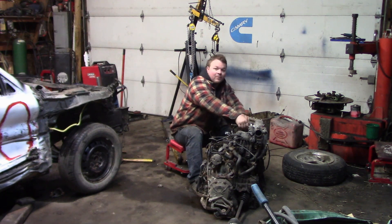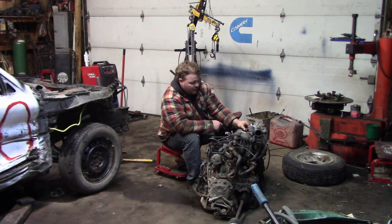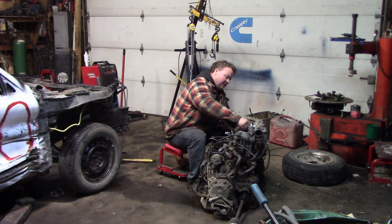So here's what we're going to do — we're going to take out all the spark plugs. I'm going to use one of the new tools I bought, which is a bore scope. We're going to take a look down all the cylinders and try to turn it over as soon as I get all the spark plugs out, see if there's any water in there, and just do a basic inspection because I kind of want it to run when it's in the car.